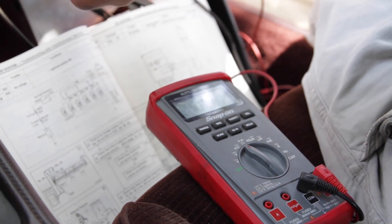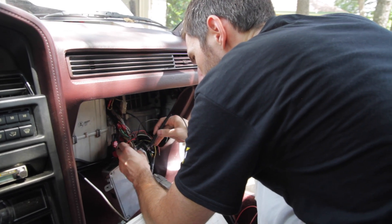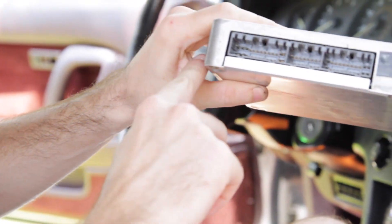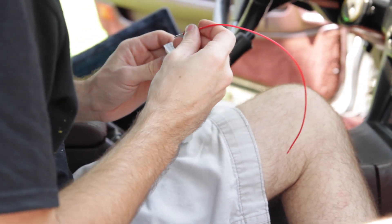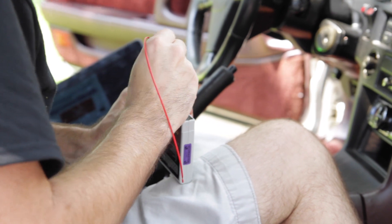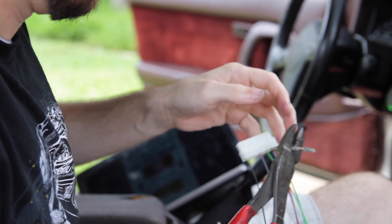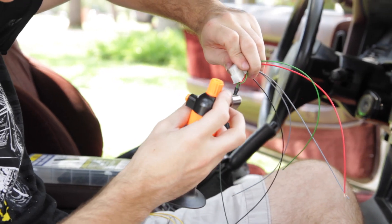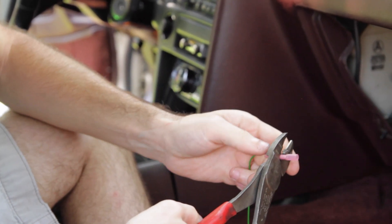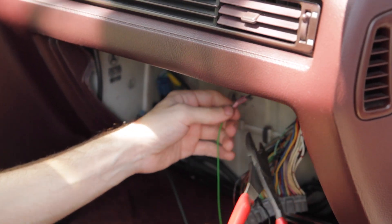You'll notice we have a multimeter and the factory service manual on hand. We were doing some preliminary diagnosis on this vehicle as it was having some issues with the factory mass airflow sensor, but it's always a good idea to have both the service manual and a multimeter on hand. Using the service manual, the DET-3 instruction manual, or a vehicle-specific wiring diagram for the DET-3, identify which wires you'll need to use for the installation. You'll notice that we're using adhesive-lined heat shrink over each of the connections we make, as well as crimp connectors covered with adhesive-lined heat shrink. Using heat shrink with adhesive lining ensures that your connections will be protected from vibration, strain, and moisture. You'll pay a few more cents for each connector, but it's a very good investment.